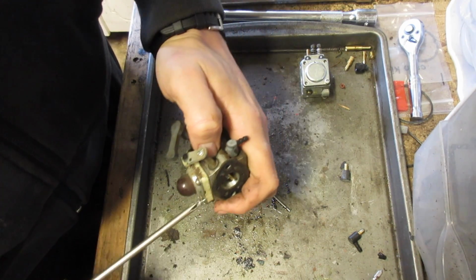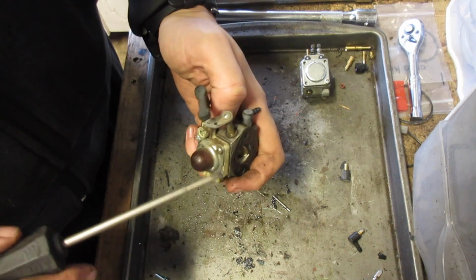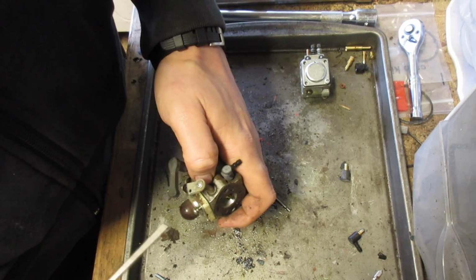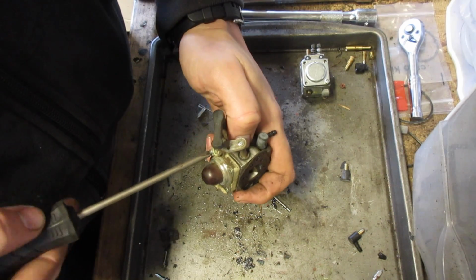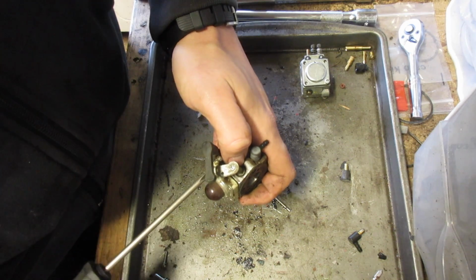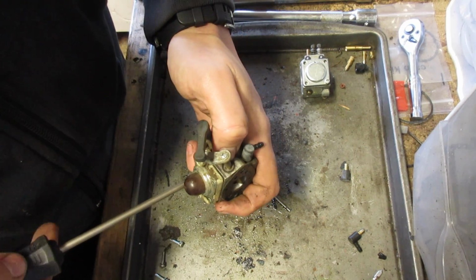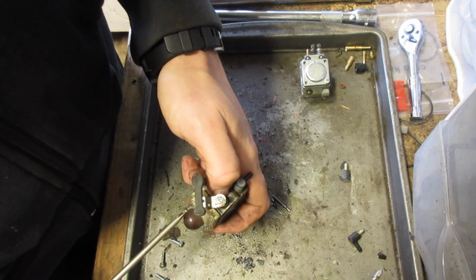Another reason why I want to take the side off and the tank out is it's going to be a whole lot easier to redo those fuel lines with the tank out. A whole lot easier. A couple minutes of taking the flywheel off is nothing in comparison. You could do that flywheel method with pretty much any flywheel. It doesn't really have to be a small one or a big one.